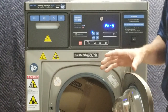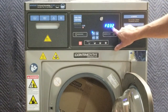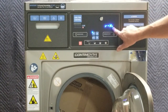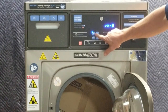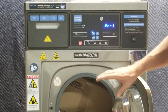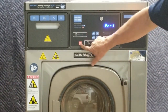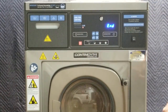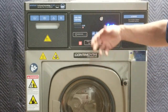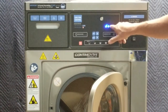Phase 10 is yes but we're not going to use that. Phase 11 — you must program phase 11; that lets the washer know the program is completed. Level three, 32 degrees because it's a rinse, no dosing, agitation high, rotation time six minutes, rinse hold no, extract down to four, extract time five minutes — and then it goes back to program one because it's completed. I can close the door and now that particular program has been created. You can create other programs by simply varying the times and agitation.